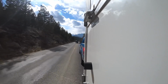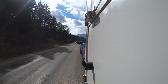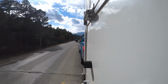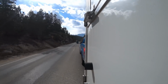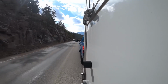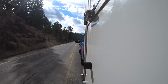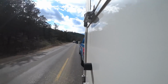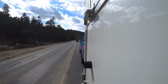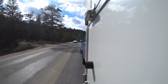And a 10-speed now, they calibrate these a little bit differently. Are you doing it with your foot? I'm doing that with my foot. Okay. It wasn't coming off. Yeah, see these 10 speeds, I worried about it when they first came out because the gears are closer. So your RPMs don't get as high, so it makes it a little harder to grade shift. But when they use the Raptor engine and the Expedition and the Limited and the Raptor, it actually will downshift and hold gears much better because they've calibrated differently.